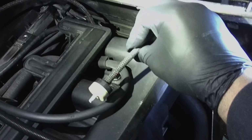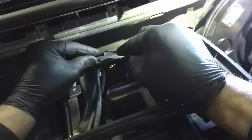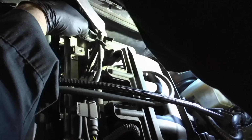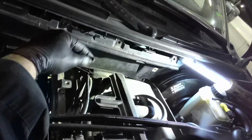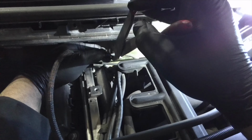Replacing all the worn vacuum lines with an updated nylon braided hose, which are the same lines used on the newer E90 N54 vacuum reservoirs that control the turbo wastegate, which are meant to handle extreme heat. Fix this guy for the secondary air valve. This thing is like baked on. These updated vacuum lines on the E46 will probably last a lifetime on the engine before it completely falls apart.